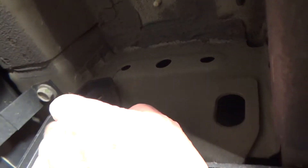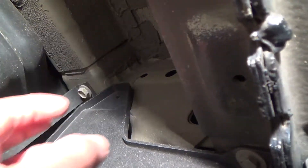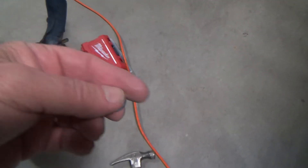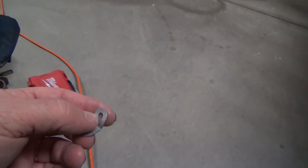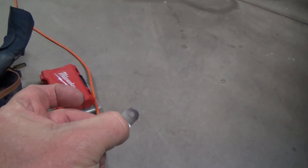There's a big hole in the black plastic, so I need a washer with a small hole but a bigger outer diameter. I wasn't sure if I had one. Then I looked up and found this — I could use this for a washer. I could break this off with two pairs of pliers, bend it back and forth until it breaks, and then I've got a piece with a screw hole that I can use as a washer to go over that big hole.